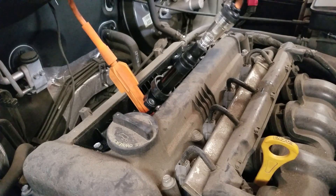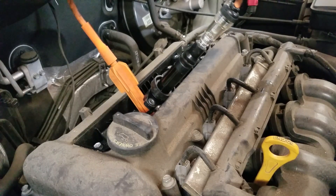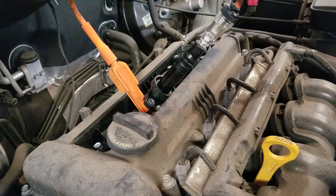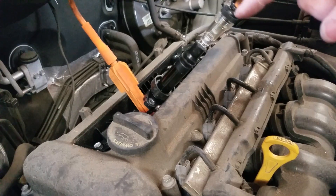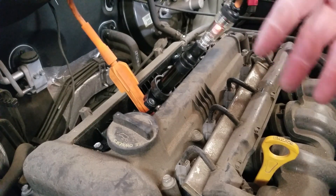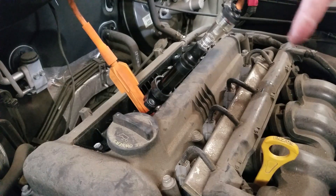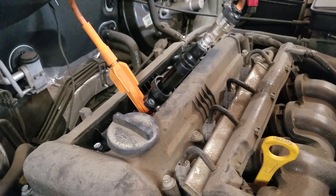Keep in mind that what usually kills a coil is a worn-out spark plug with a gap big enough to drive a truck through — and that was the case here. What I found is that some Kias shipped with standard Champion resistor spark plugs, which were worn out by 60,000 miles. If they had used iridium or double platinum plugs you could probably stretch it to 100,000 miles, but I wouldn't want to leave any spark plug in an aluminum head for that long. Anyway, thanks for watching — see you later.